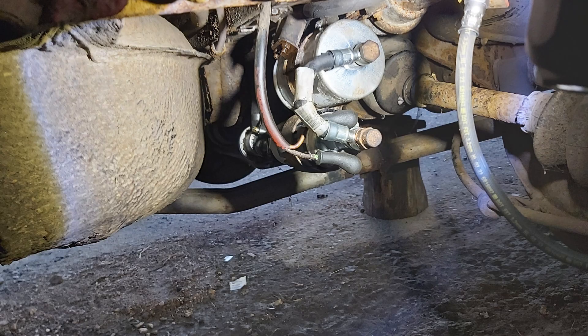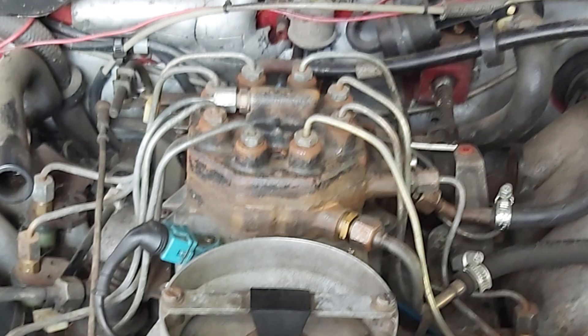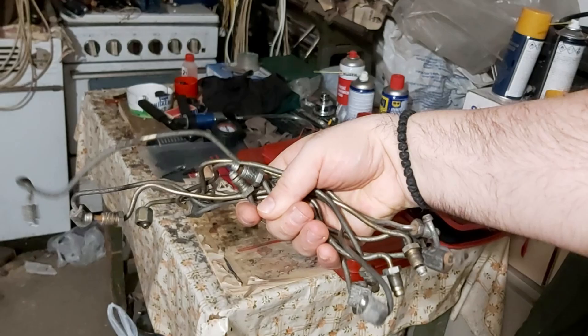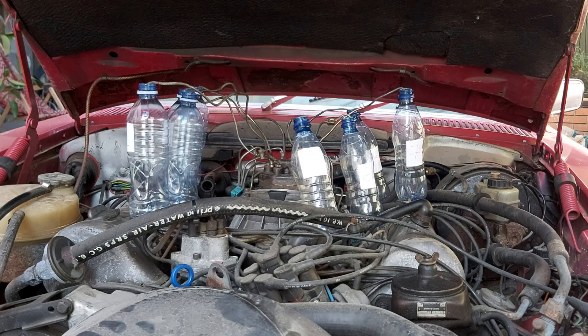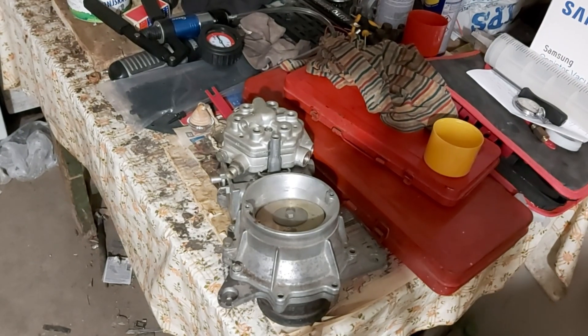The goal is to make the pump run continuously under system pressure without the engine running. Connect the hard lines going to the injectors, attach flexible hoses and insert them into numbered bottles. Make sure the setup is secure — no leaks, no kinks.